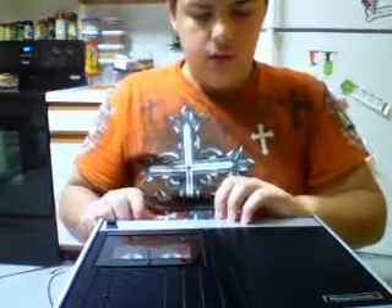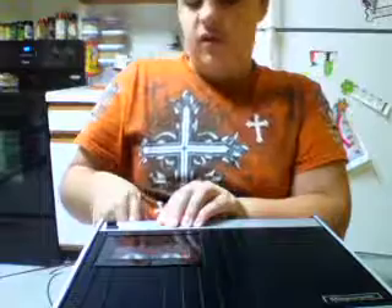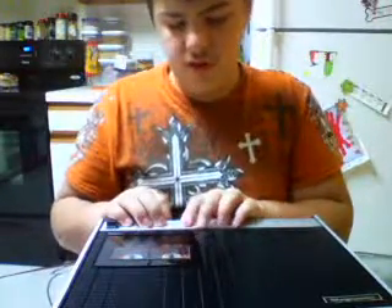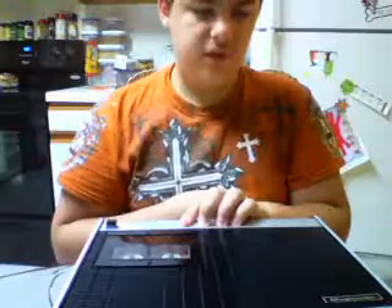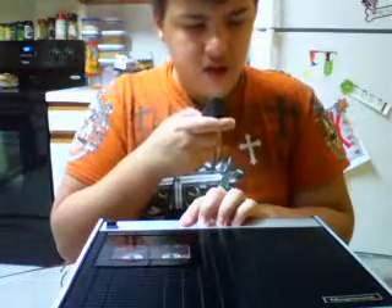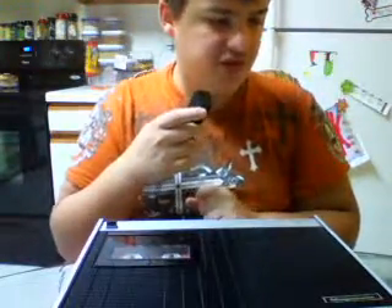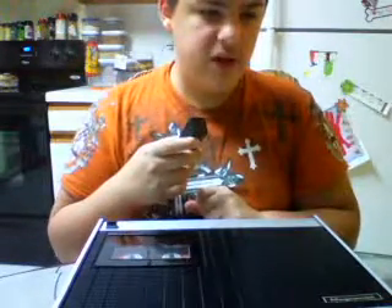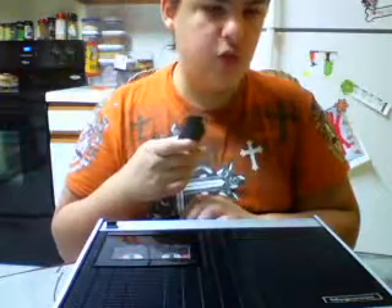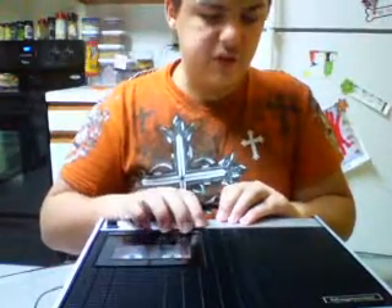Let's make a recording off the radio. I have it set to automatic level control. I'll press the record button — and yeah, lots of noise. I turned the speaker monitor off because it's pretty loud when recording with automatic level control. It does not record the mic when recording the radio. You can turn off the mic switch and it'll stop recording, so you can use it as a remote pause while recording the radio — a cool way to pause since this has no pause button.